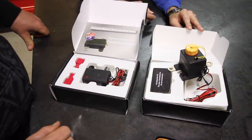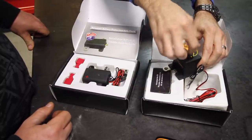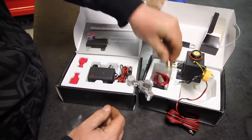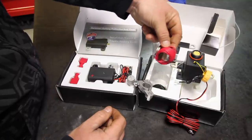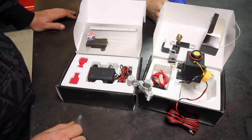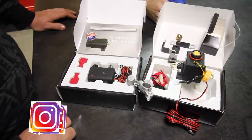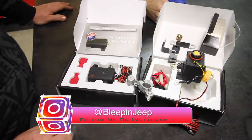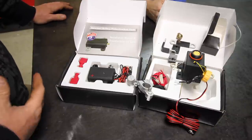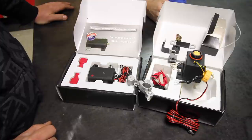The larger model has a big on/off switch on top of it, and you can get it with a key fob option as well. It comes with a side terminal bolt, which is nice for a lot of GM stuff. It has a fusible link and a ground wire. There's also a little terminal — if you want to make sure your radio doesn't lose presets, you could hook your radio presets up to that. It provides a never-going-to-shut-off power source for things like your clock. If you wanted to rewire that fuse, you could easily do that.